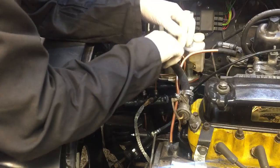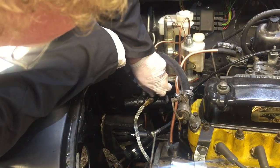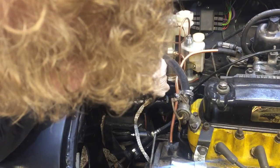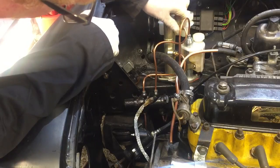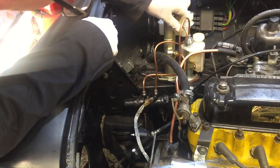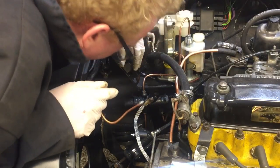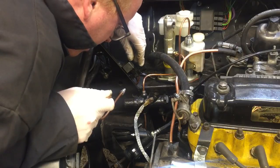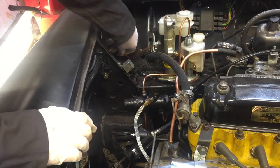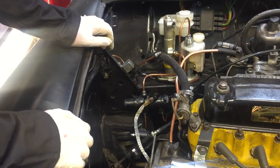All of a sudden I felt it being a bit loose, and the thread has gone in the compensator valve. It's got a bit of thread further down, but because it's a brand new brake pipe it's not crashing down. I think it's just not worth risking — not worth risking the wife's life. So I think the only way is to get a new compensator for the front, and hopefully they're not too much, but that puts a stop on bleeding the brakes today.